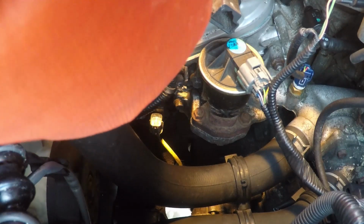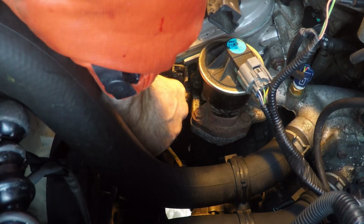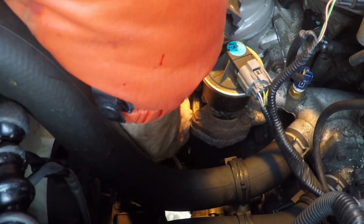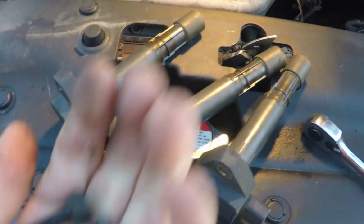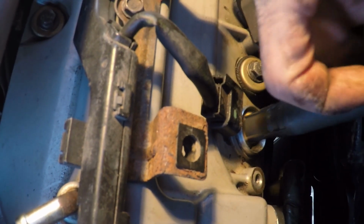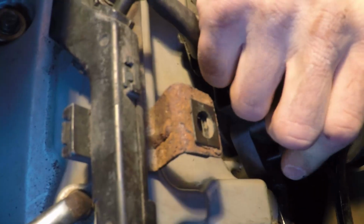And it's a little difficult to see because you have to reach down fairly deep, but they're the O2 sensor number 2, as well as sensor number 1, which also connects to this wiring harness on the driver's side of the engine. So there you can see sensor number 1's connection. Sensor 2 is deeper, and there's the 3 bolts that secure the ignition coils, and they simply insert into the spark plug well and are secured with the 1 bolt.